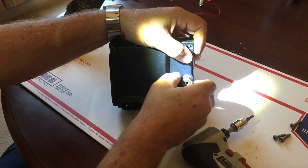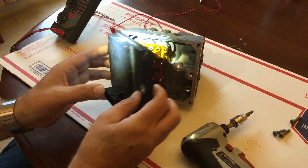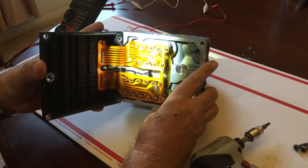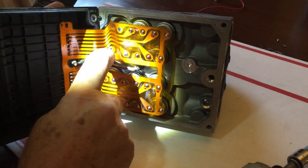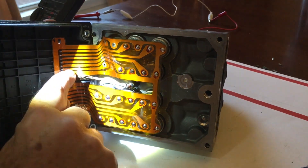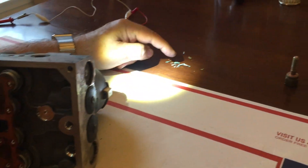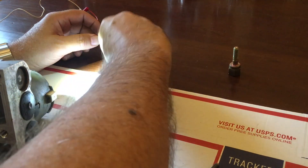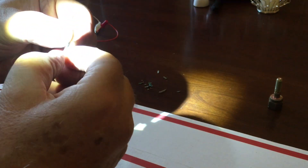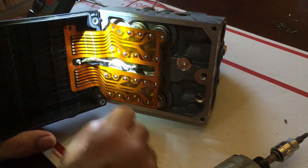This is just a mounting bolt that mounts it to the frame bracket. You open this thing up and it swivels open — it's got a little ribbon cable in here, and you can see this big wire. Right now you can see it's a bare wire, and that's supposed to have insulation on it across the entire thing. Look over here — you can see the remaining insulation that peeled off. This stuff is just totally brittle; you can just break it off and it just crumbles, and that's what happened when I opened this up for the first time. It just all crumbled off.